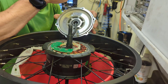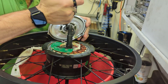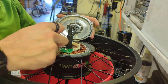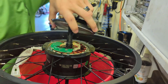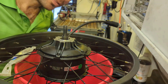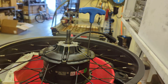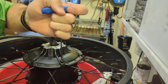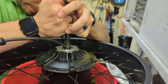We use the gasket maker all around the motor plate cover to really seal it in. You'll notice we put the gasket sealer into a syringe — this makes it way easier to apply because using the original bottle in a caulking gun the stuff shoots out and is very messy and hard to wield. Also, once it gets into your clothes it's a pretty bad stain. Putting it in the syringe makes it way more controlled. As the bolts get tightened you can see the gasket maker ooze out all around the sides — that's a good sign, and it should be even all the way across, which is how you know it's fully sealed.